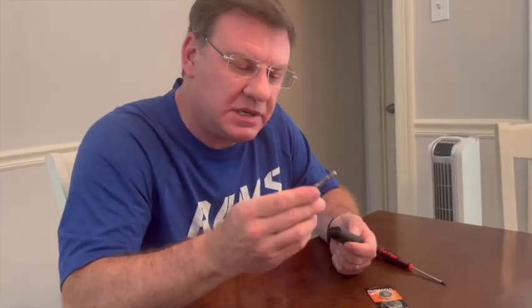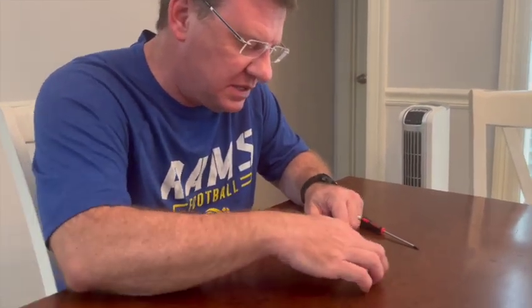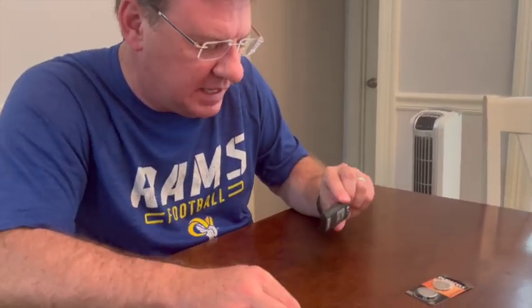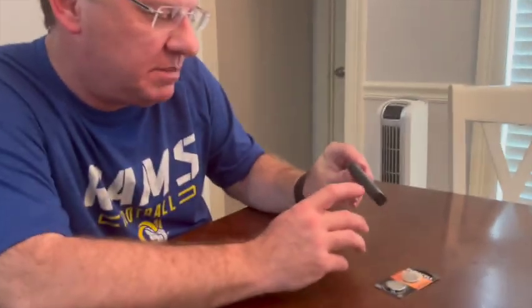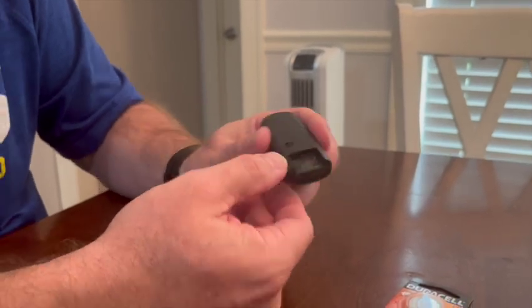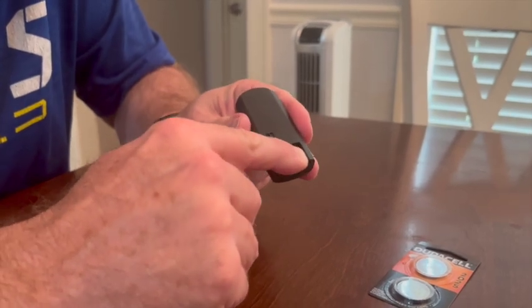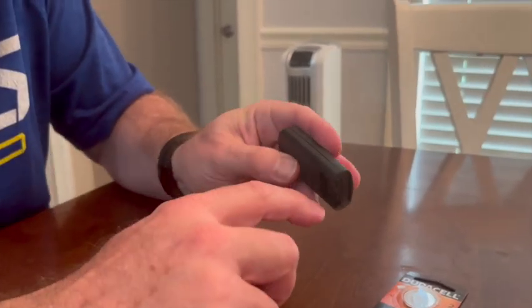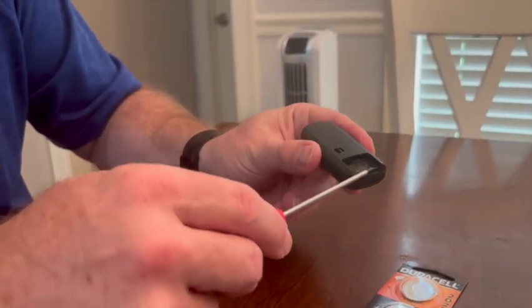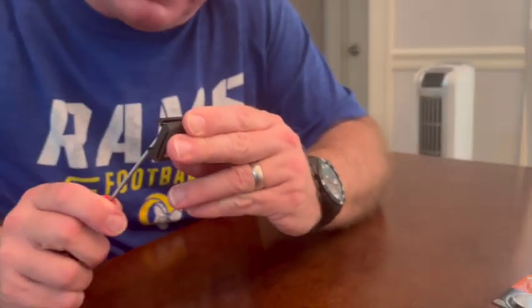To change the battery, we take that out and use a small flathead screwdriver. What we want to do is separate this plastic right here, but that's a small groove to try and get something in. Where we just took this key out, there's a ridge right here at the top on both sides. You just stick that flathead right in that ridge and twist the screwdriver, and it lifts apart right there.